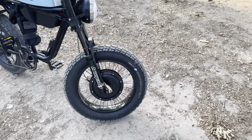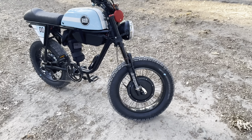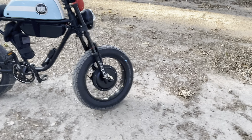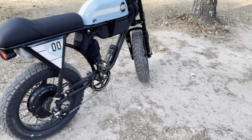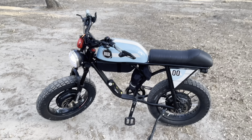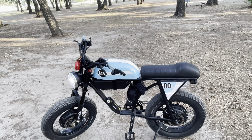On the ride so far, really good. I had them at real low pressure last night — ran up and down the street a couple times at about 15 pounds of pressure. I've since almost doubled that. These tires say they can do around 65 pounds, but I don't think the tubes inside can handle that.